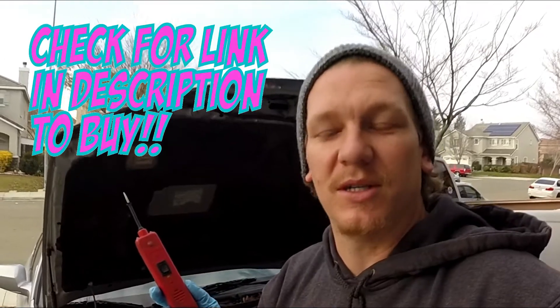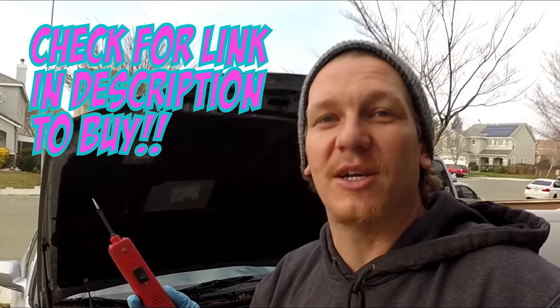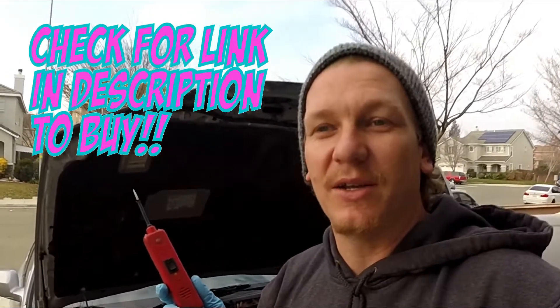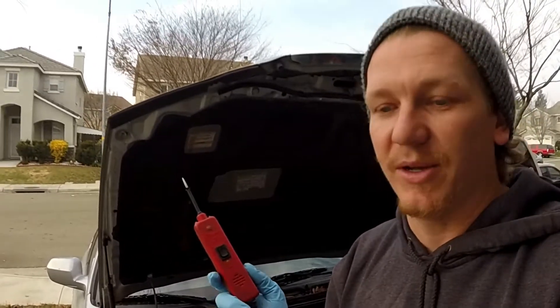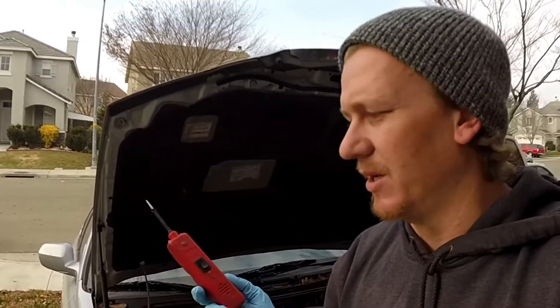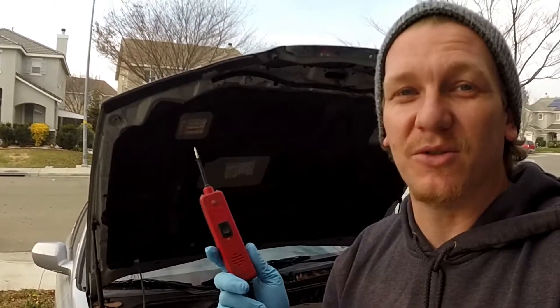It helps me do so much so quick — checking if a circuit has power or a ground, to follow or chase an electrical problem. Like if your headlight isn't illuminating properly, you could check and make sure that the plug has power or ground with this. You could also give that circuit power or ground if you felt like that would change the outcome, but you can fry stuff doing that too. I've never fried anything using this thing. I love it, I use it a lot.